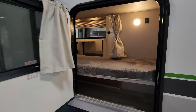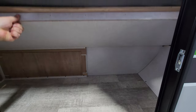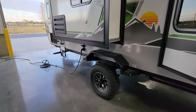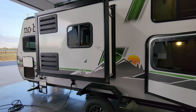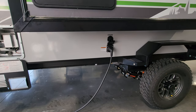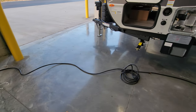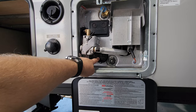There's the little storage door — this will flip up so you could put small bikes in here for the kids, and you've got that light and USB charger port there as well. There are not a huge amount of changes for the Nobo this year, but it's still got that same great look. You have a cable inlet, a detachable 30 amp electric cord that's about 30 to 35 feet long. Then there's a six gallon gas/electric water heater — the electric switch, heating element, and inch-and-a-sixteenth drain plug are right there.